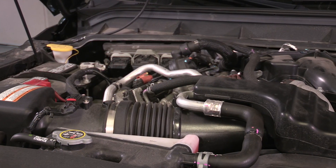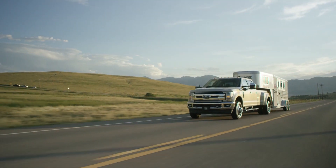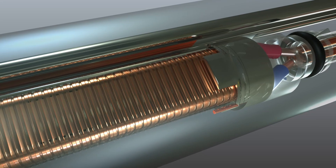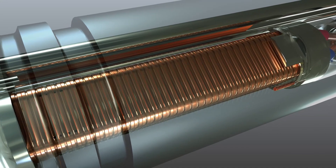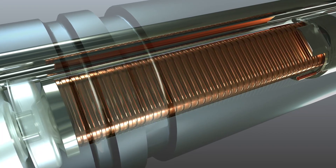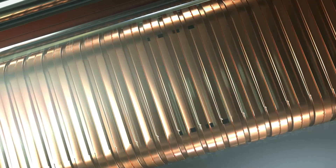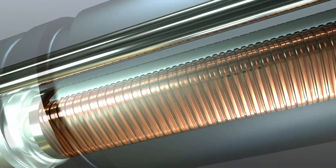Here's how it works. 6.7-liter diesel engines are precisely engineered to extremely tight tolerances, which are critical to generating peak horsepower and torque. 6.7-liter diesel fuel injectors use piezo actuators, rather than solenoids, to precisely control fuel injection. This piezo design is a benchmark for minimum pilot injection quantity and injection rate, providing important volume stability over the lifetime of the part. To do that, it relies on driver technology that incorporates hundreds of piezo-crystal wafers. These wafers respond quickly to electrical current, allowing rapid expansion and contraction to control the flow of fuel.